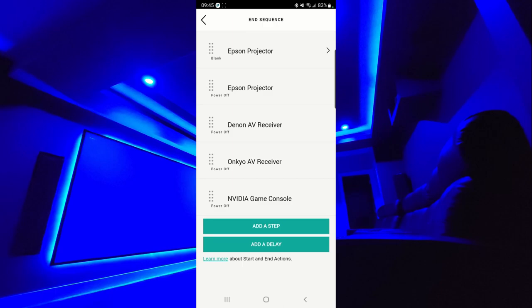The edit end sequence right below it is how to power everything off, and this is where I was having the issue and this is how I fixed it. The very first thing you'll see is Epson projector, and the step that fixed the power off was adding in a blank — that is it. No delays, no weird changing of the power signal to certain seconds or lengths. Simply adding the blank before the power off fixed the issue and it has worked flawlessly ever since. The rest of the steps just turn off all the other items that were previously turned on.